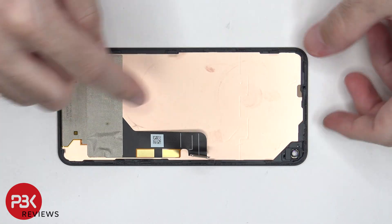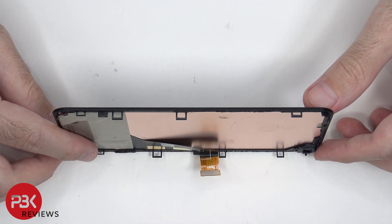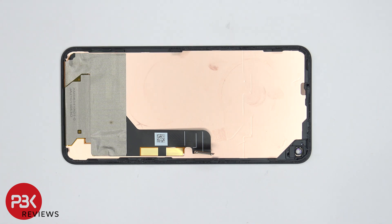Taking a look at the screen, there's a plastic frame bordering it, which has multiple clips around it to ensure a secure seal. There's also the adhesive water-resistant seal around it. If you get a replacement screen that didn't come with this plastic border, it's just held down with some adhesive, so you apply heat, pry it off, and reapply it with new adhesive to your replacement screen.